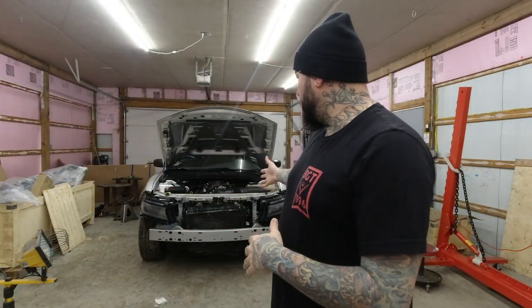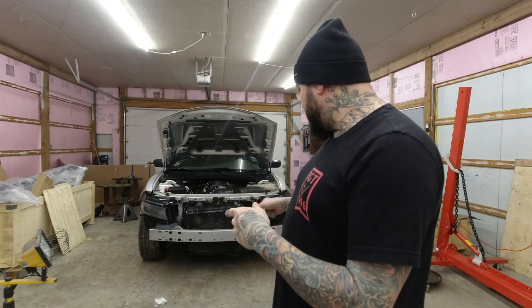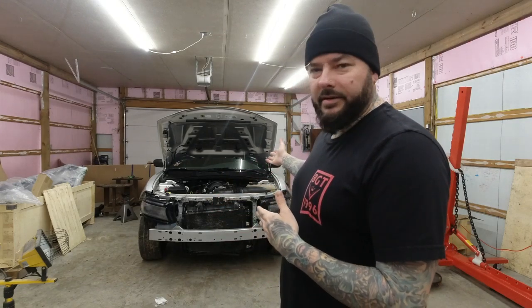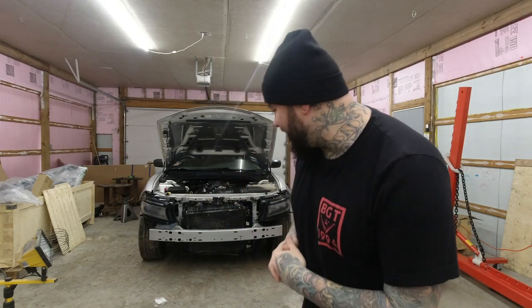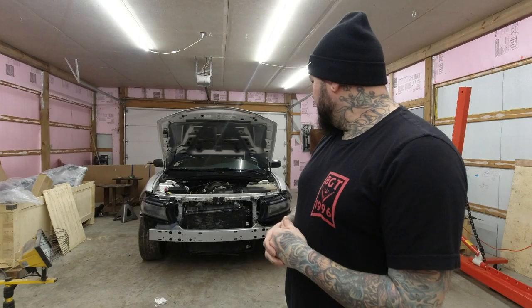What's cracking - today I'm back to work on the dodge charger police car. My plan today is to try to get the radiator out, the fan out, and the AC condenser out. I think the AC condenser is good even though I bought another one - it's still holding freon. It does look kind of banged up at the bottom, so I'll probably just go ahead and replace it because I have all the parts for that, including the lower cradle.